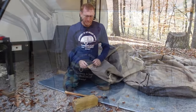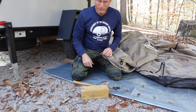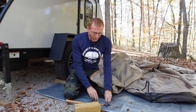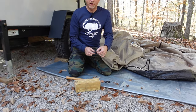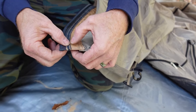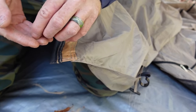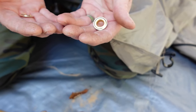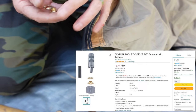Let me get the tools we're going to need and we'll do this right now to ours. We're up at our campsite so I don't have a workbench — I'm going to do it right here on the ground using a piece of wood as a block. What we're going to do is install a 3/8-inch grommet in this material right here at the back of the bolt rope attachment point. That gives us a place to attach our halyard line, reinforce it, and make it a lot stronger. The grommet is a two-piece brass grommet — we'll put a link to a simple kit on Amazon.